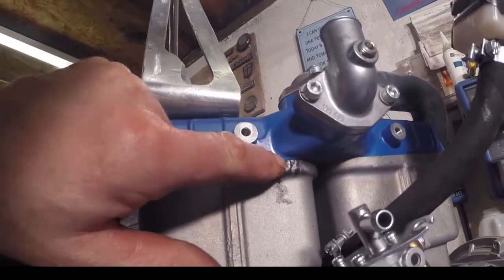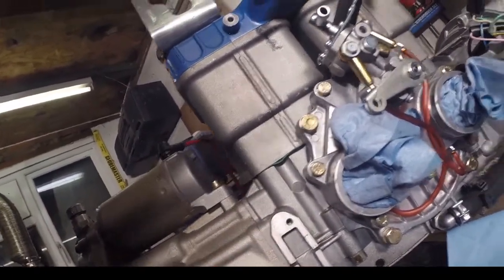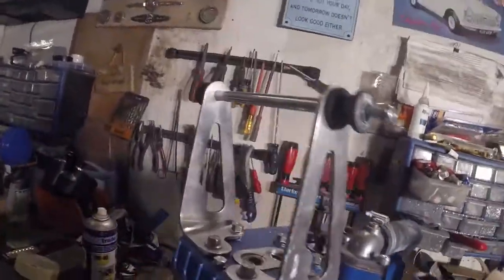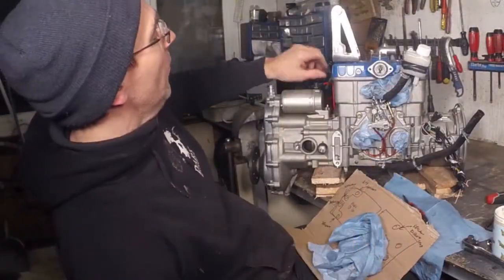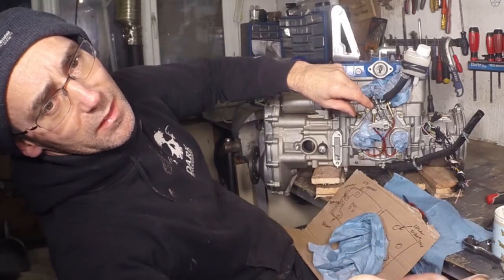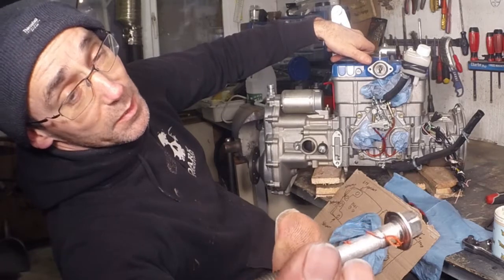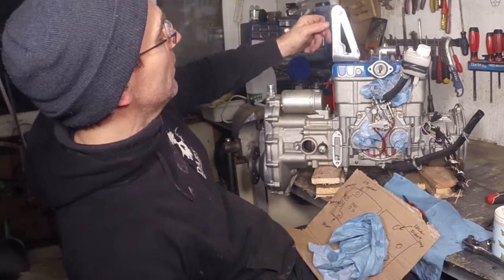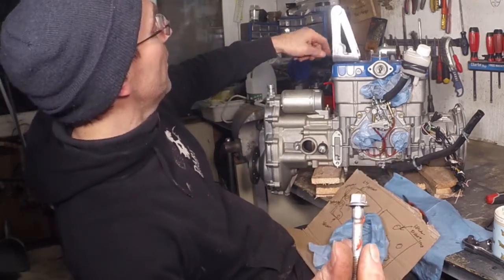I must say I'm not too keen on the look of this. Looks like it could just be grease, but it's in a suspicious place. I think next I'm going to undo some stuff on the top. Some of these bolts I put extra sealant on, because they're holding on these extra brackets and bits and pieces. When there's no bracket, the flange part of the bolt is meant to seal down onto the top of the cylinder head — so I've been told. So with a bit of lithium grease, that then creates a good enough seal.